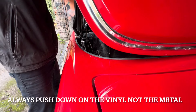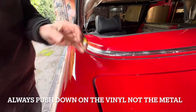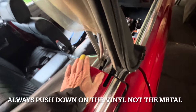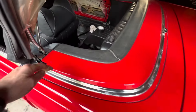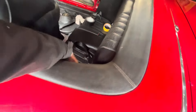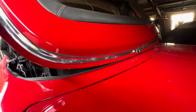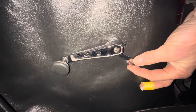First thing you need to do is make sure the soft top roof is all the way out and then you should hear a nice little click. Then go around to the other side and click that down as well — that is the point of no return. Now the question is: when we click this handle down, does the clamshell open? It does — so that's perfect. Now let's see if we can put the soft top down and see if the hook disengages. The first thing you have to do is move this handle up slightly, and that will move that hook out.